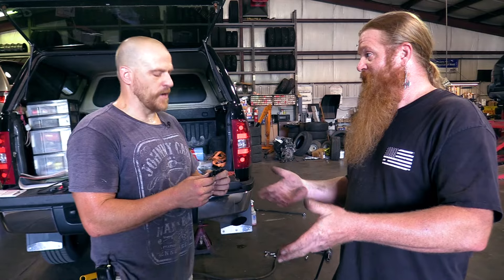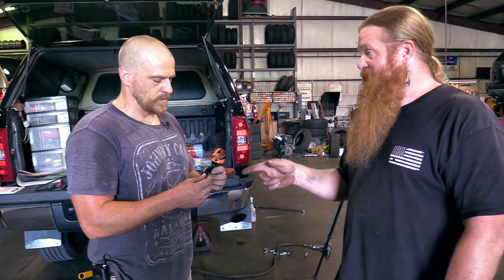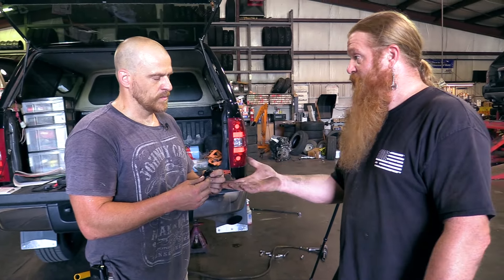Which is nice for cars where you've got to enter it manually with a snap-on scanner because you don't have the factory tool. You've got to erase them all and do them all. If you clone one that's broken but not dead, you don't have to do any programming — just put it in and it's done.